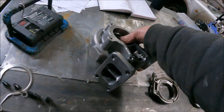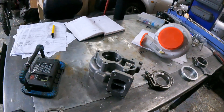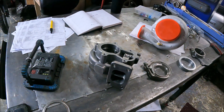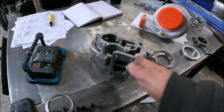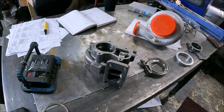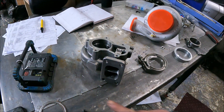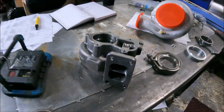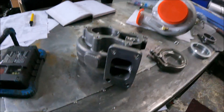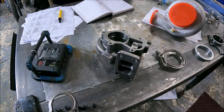It's a lot of work, so I wouldn't necessarily do that, but it's an option. This way is super easy and worthwhile — it will improve spool. A lot of it isn't about maximum flow, because most people would never max out the turbo anyway. This is about smooth flow, so it's mostly about helping spool up. And if you haven't got twin scroll to help you, you want all the help you can get — a nice small 8cm turbine housing, smoothed out, is going to get your turbo spooling faster.